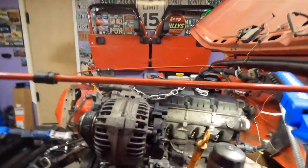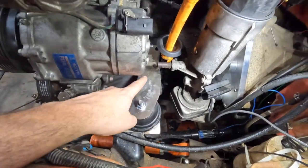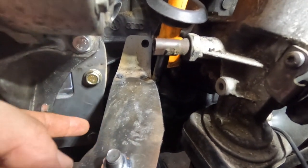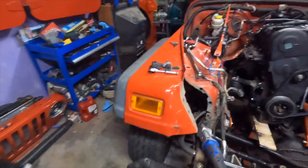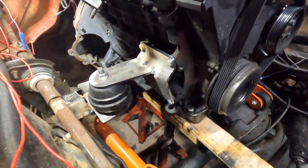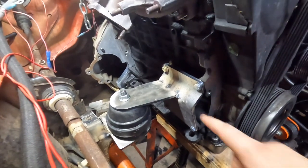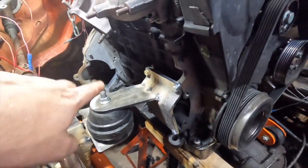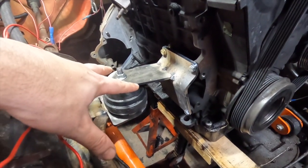I'm going to hand-hold the camera so you can see closer what I've been doing. I've gotten all the tacks on my motor mounts and I'm really happy with how they've turned out. I have that one tacked in with two really good tacks. I'm going to have to brace it underneath and really weld all of it up, as well as welding this plate into place. Over on my driver's side — which is normally the passenger side — here is how this one's looking. I have three really good tacks on that bottom mount as well.